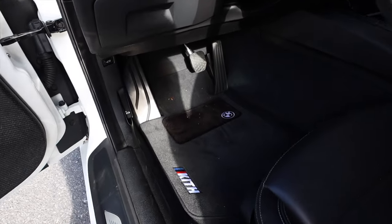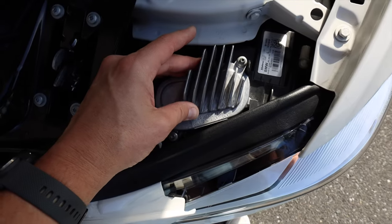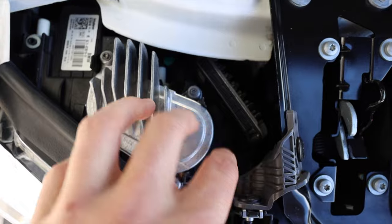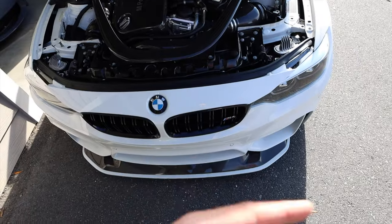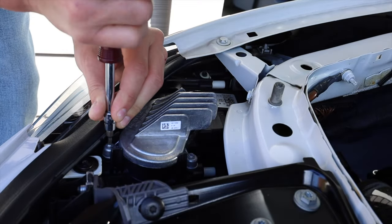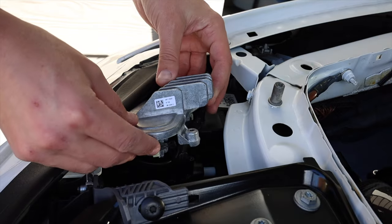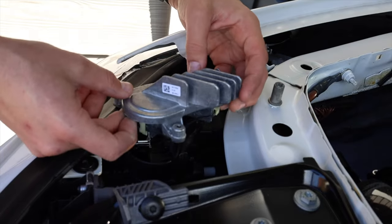In order to get to the headlight module, obviously we're going to open up the hood. Headlight module left is right here, headlight module right is right here. You've got a couple of Torx bolts — looks like T20s. You take those three out and then you can pull the entire headlight module out with the chips, and I'll show you guys how to swap over the new chips. On the back of the module there are two plugs that you need to undo — they go into each chip.